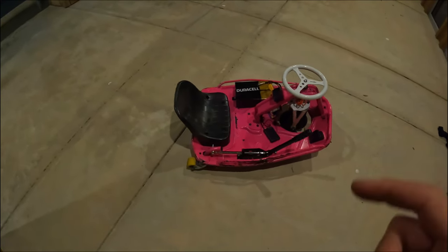After that, you have to run the wires a little bit differently than you would on a stock cart. They have to come up through one of the tubes on the neck here. And then I drilled two holes in the fork itself to use a zip tie to hold these wires down. And then I used a few more zip ties to hold the wire down around the neck here. What this does is it prevents the wires from getting caught on anything when you're spinning the wheel around. So on the motor wires themselves, you want to leave a little bit of slack, because that allows you to fully turn the steering wheel either direction, just over 180 degrees, without tugging on any of the wires or anything.